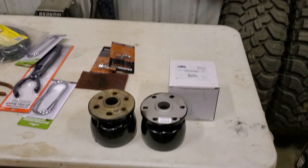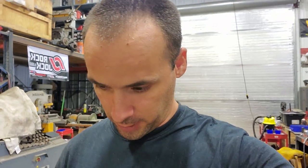On the upside, today, since we had the motor up in the air, it was really easy to access. I at least managed to change the oil on it, new filter, new fuel filter. Also put new belts on it because it was definitely a need. And while it was up in the air, I crawled in, cleaned out the bilge underneath.